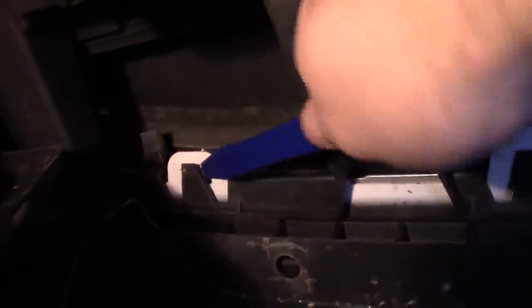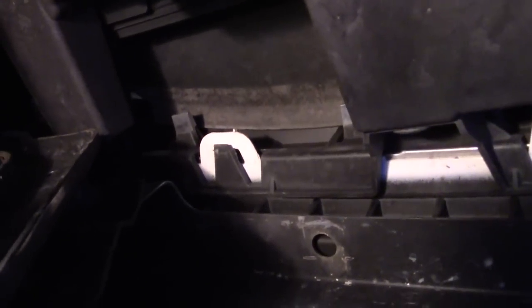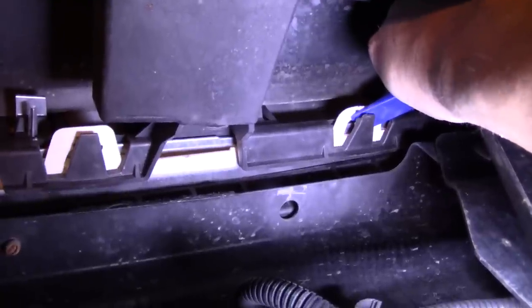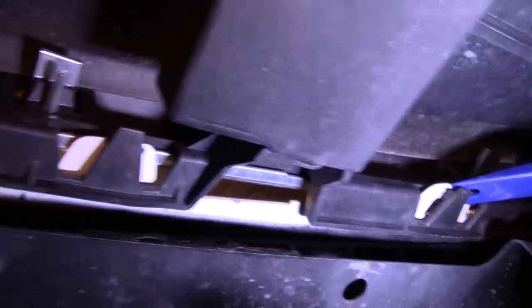I'm straight under the truck here. You can see the white piece is the valance, and you've got a little black tab. I'm going to use this trim tool to wedge it out. The corner ones are going to be tough to get, but we're going to start in that corner, work our way across, and end up in the other corner. Definitely if you're two people it would be a little easier. I've just been wedging this in to get the corner started. These just clip into those little notches. I'm going to wedge the tool up in there the same way and we'll be free.